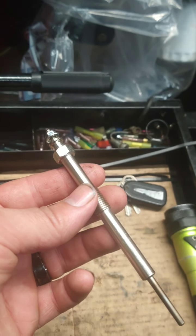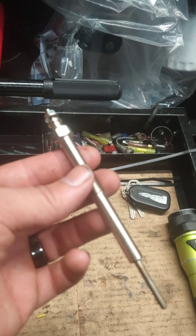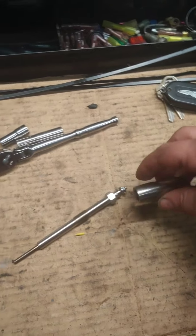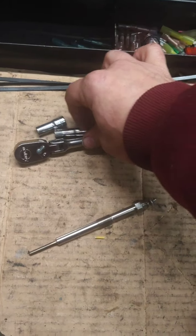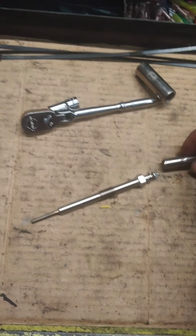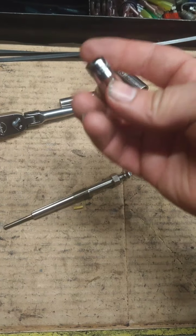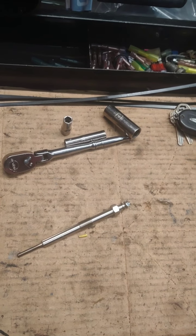Here's a new glow plug for a 2012 Chevy Duramax. This right here is a 12 millimeter that'll go on to pull that out. This is an Autolite one. This nut right here you can use a 7 millimeter or a 9/32nd. You can use either or — it doesn't matter, they both fit good.